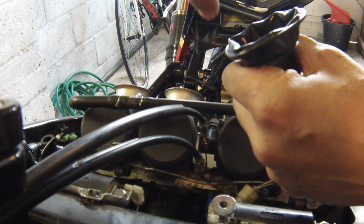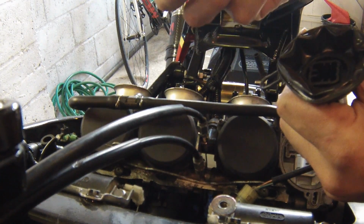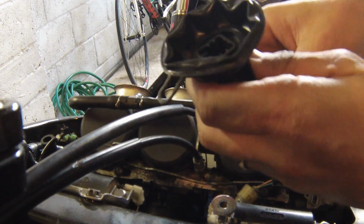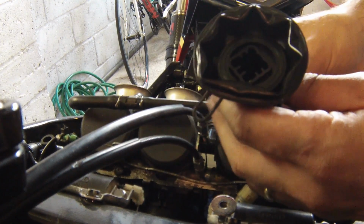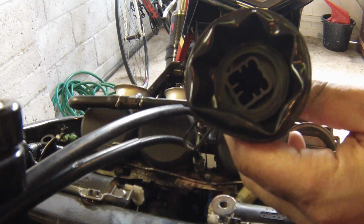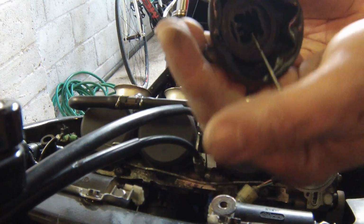He says, slide out first of all the retainer on top there, so put that aside safely. And the next thing in there, you can now actually push the needle up. Now be careful, because there's a couple of small washers on here, and the last thing you want is those dropping down and getting lost. So I'm just going to tip those gently out.